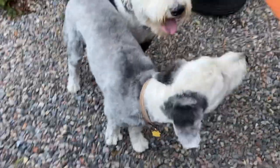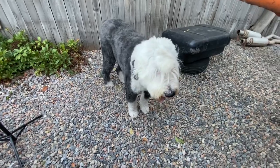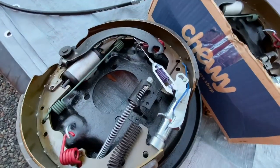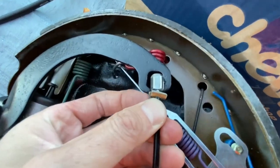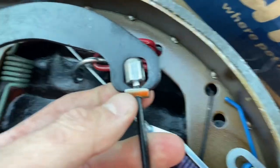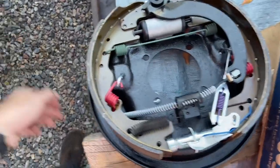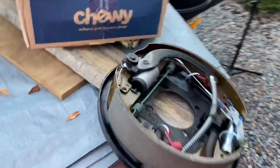Looks pretty good! Getting this guy worked in here like that, and then this goes right into this slot. Now this little retainer clip retains it so it won't pop out and we don't lose our braking power. Now we can install this onto the truck and as you pull on the cable it's going to make the brake function.